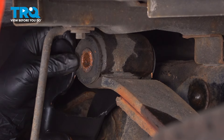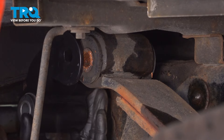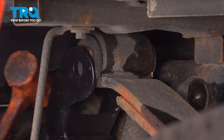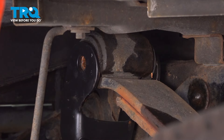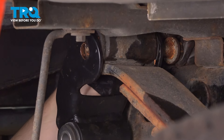The shackle is going to be a snug fit, so you're going to have to kind of squish it over a little bit. Maybe tap it with a rubber mallet if needed. Just try to line up that bolt hole so we can get the bolt through. Both of the bolts are the same, so it doesn't matter which one you put on top and which on the bottom. If you have to replace them, definitely do — if they're rusty, weak, or stripped out in any way, replace them with brand-new bolts of equal hardness. These have to carry a lot of load.